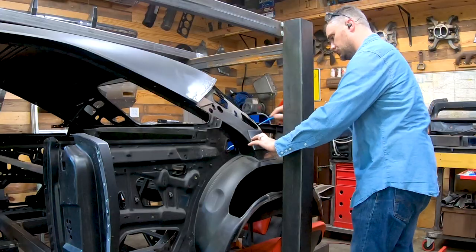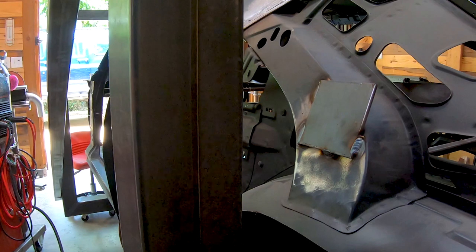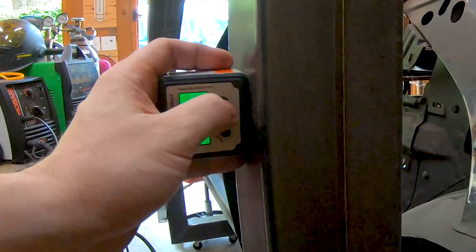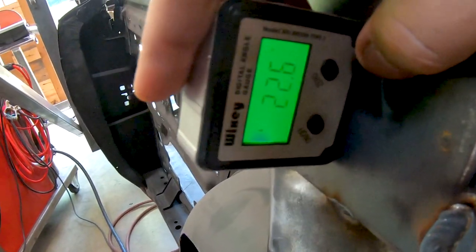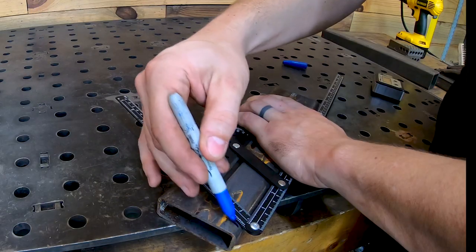Then, it was down to securing the unibody to the birdcage. Remember the plan from last time? Secure the uprights to the unibody bulkheads, basically the A and C pillars. And one bit of detail here. I welded on a fat quarter-inch plate to the 16-gauge unibody to improve the overall strength of the mount.